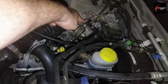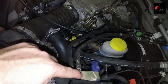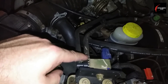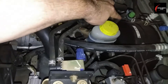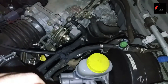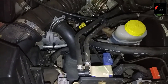By connecting my vacuum gauge to this hose where vacuum is created in the intake, I've basically checked the integrity of the whole hose and the solenoid together. EVAP purge solenoids stay closed at rest — meaning no power going to them. You'd also want to check the condition of this hose, the connector, and then your green EVAP Schrader port valve, which will help you diagnose whether you have a leak and where it's coming from.